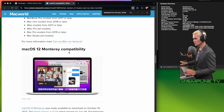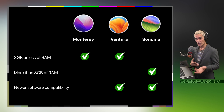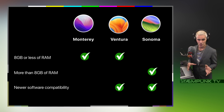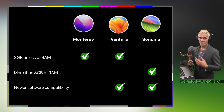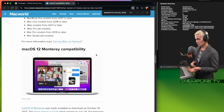But I'd like to downgrade to Monterey. The reason I'm going to use Monterey on this computer is because it's going to be a production machine. From my experience, Monterey has better compatibility on a professional production computer. Ventura is also really good, especially if you want a newer stable version but you've only got 8GB of RAM or less. Sonoma is fine on newer computers and is actually a requirement for some applications — for example, if you use the Adobe suite with a subscription, you need Sonoma. But I'm going to go with Monterey.